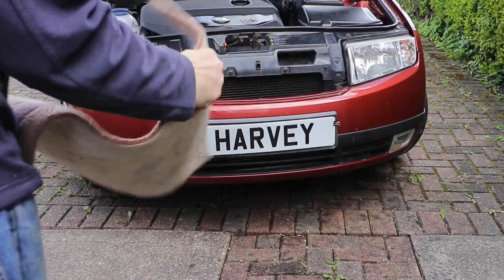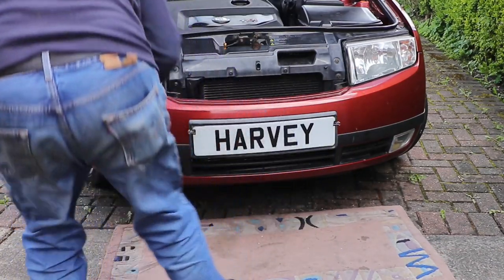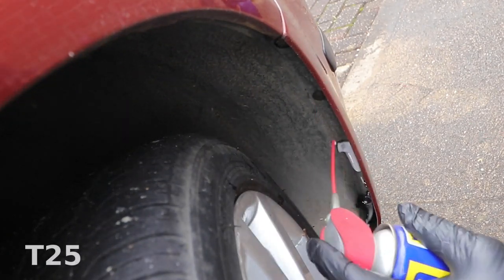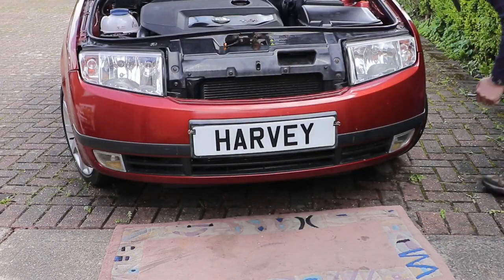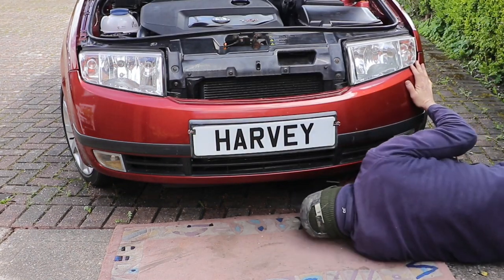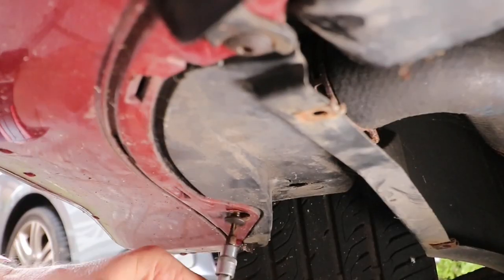I'll just run through this quickly. If you want a more detailed version of how to do this, then I'll leave a link at the end of the video and in the description. Take out the T25s under the wheel arch on each side. Then a further two T25s on each corner underneath the front of the bumper. Just here.